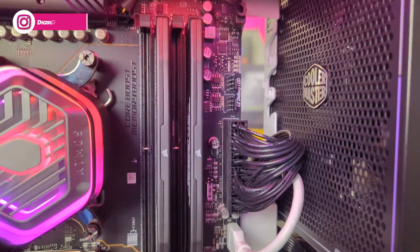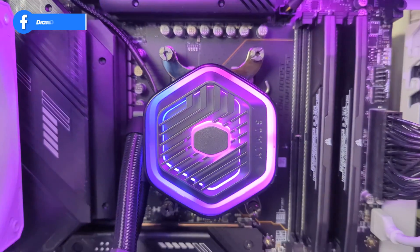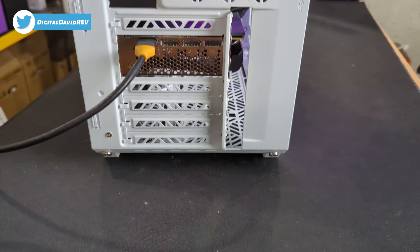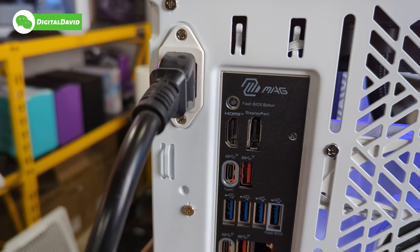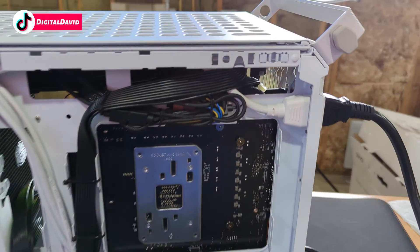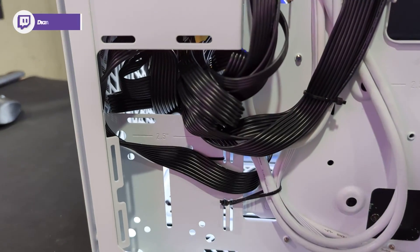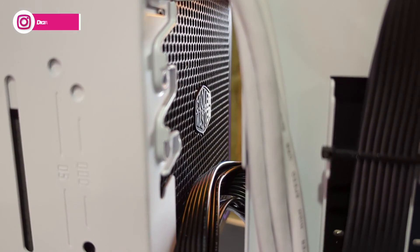There's the main board power there. Moving up to the top, you'll see our CPU power — AMD 7600X underneath. Looking at the side, down at the bottom you'll typically find your power supply, but not the case here. GPU, motherboard, exhaust fan, and up in the left-hand corner we have our power cord hookup. On the back side, you'll see how some of those cables are routed: up at the top, our CPU power; main board power coming up and through right there; and everything tucked in the rat's nest down below. We can even see the power supply peeking through right there.